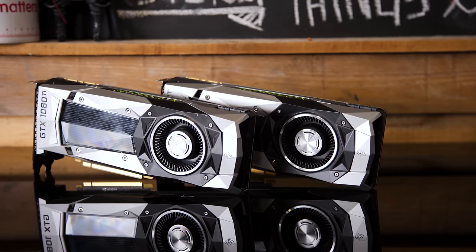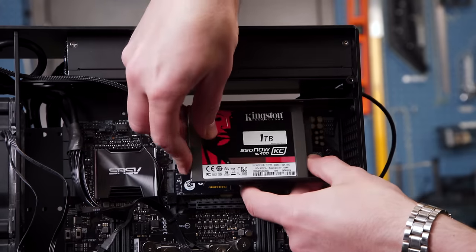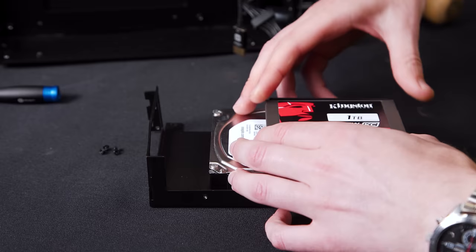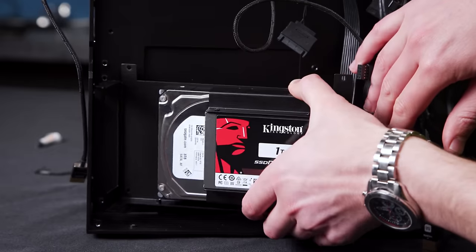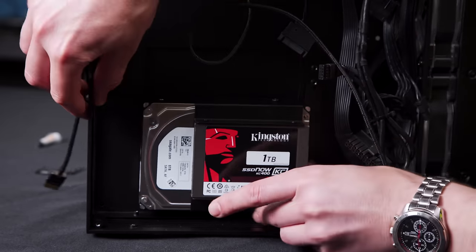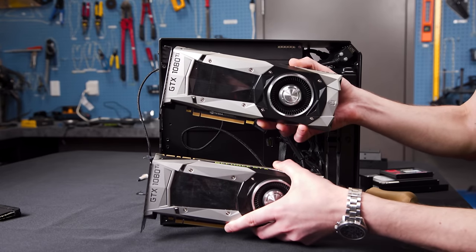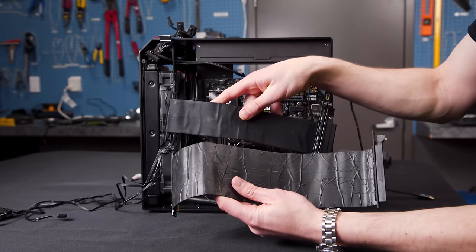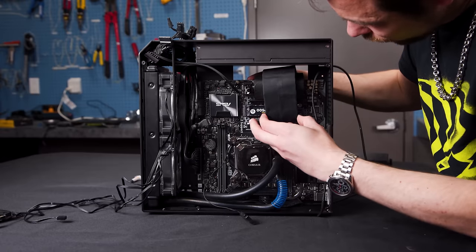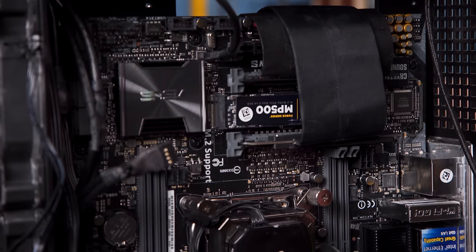Let's pop the graphics cards in. The design comes with brackets to fit a pair of 2.5-inch drives on the motherboard side, and a 3.5-inch drive plus another 2.5-inch to piggyback on top in the second graphics card tray if you're not using it. But we are using it for twin GTX 1080 Ti Founders Editions, so there will be no junk in the backside for us. These shielded PCI Express risers go in now — note that one of them is more narrow than the other in order for the SLI bridges to fit.